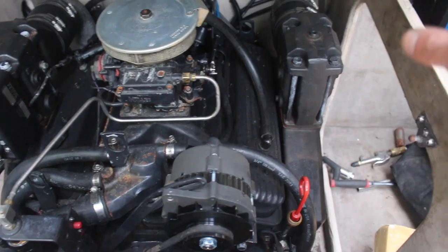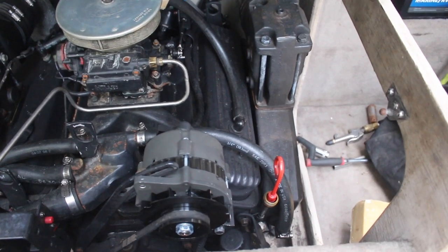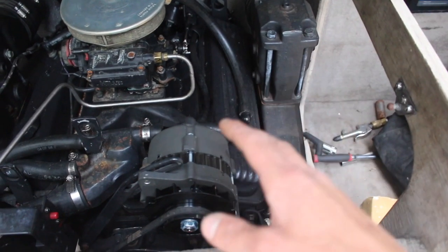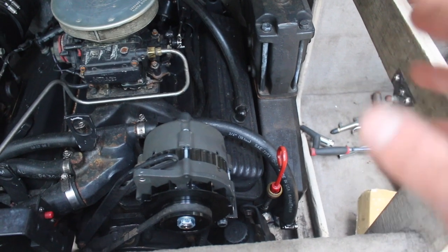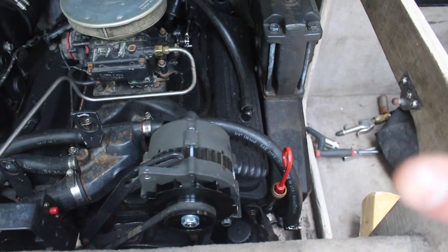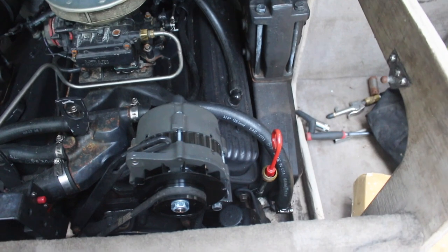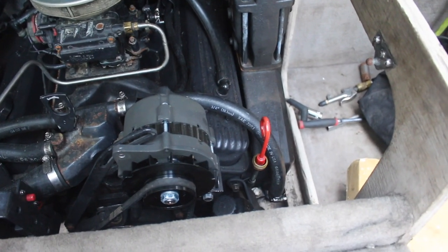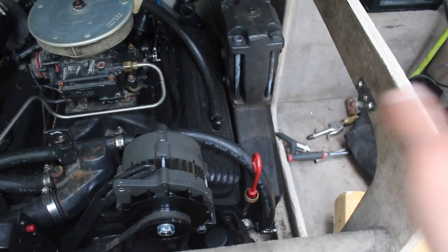When I looked at it, the guy told me, hey, I had water and low compression in number 3 and number 5. He gave me a compression checker. We checked it, and he said it was going to blow 60 psi. They both blew 120, so I don't know if he did the trick where you put a little oil in there and it seals up the rings and can blow better PSI. I doubt it because I pulled the plugs first and it did blow water out.